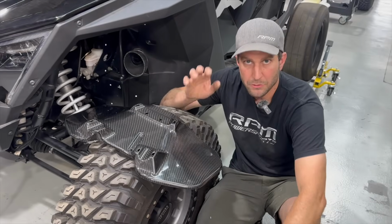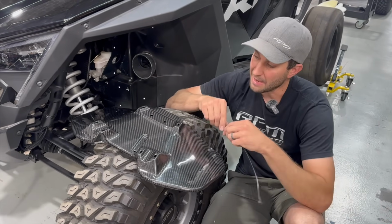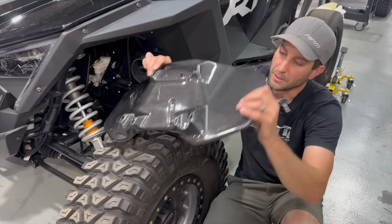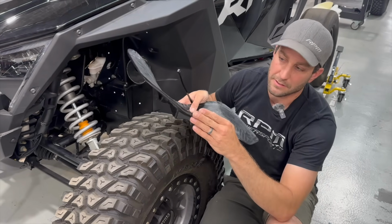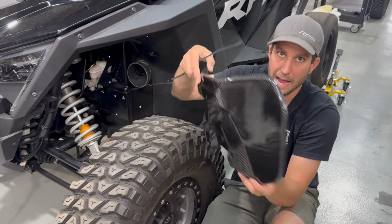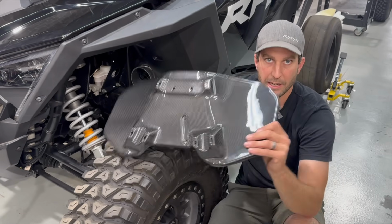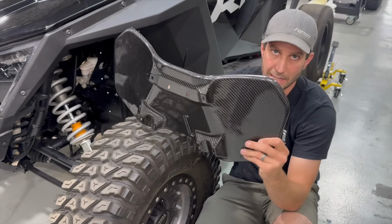All right guys, after you spray some soap and water on the radiator hoses, if you have a second hand, someone to push down the radiator hoses as you push this through, your radiator hoses are gonna press on this. Clearing this with the radiator hoses, once you get past it, everything's gonna fall into place. Securing the zip ties, do that after you get it in there. This thing will kind of fall into place and you'll see how it's gonna work.